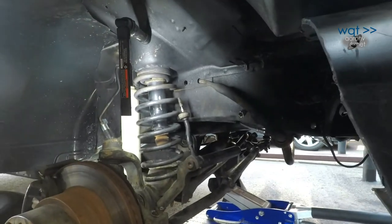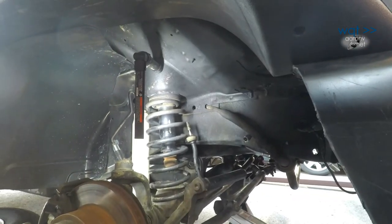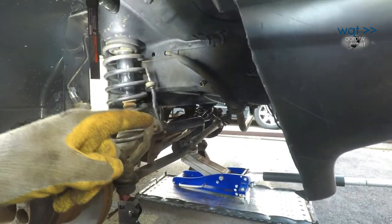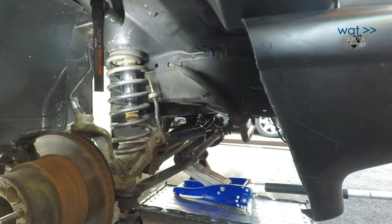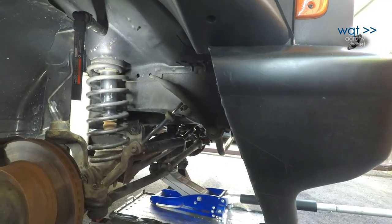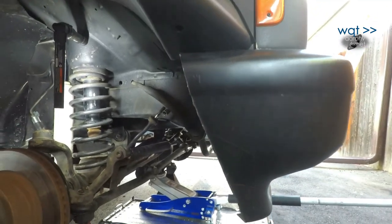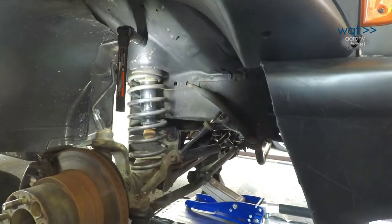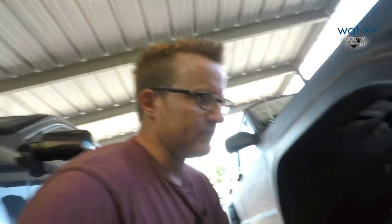And that means this next step is actually extremely dangerous if it's done carelessly, because what I need to do now is lift the axle up again under the differential, move the jack stands under the frame, and then very carefully and slowly lower the axle until the springs are loose. At this stage, if anything is done carelessly, either the axle could be popped down away from the vehicle, destabilize everything, and then bring the whole front end crashing down, or the whole vehicle might just drop. Got to move forward, so let's give it a shot.